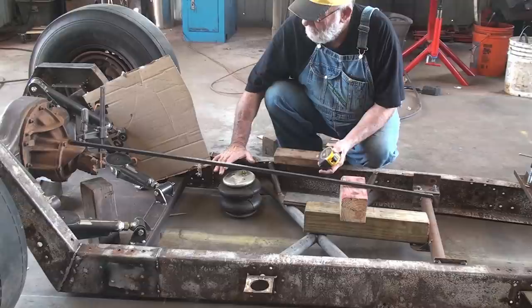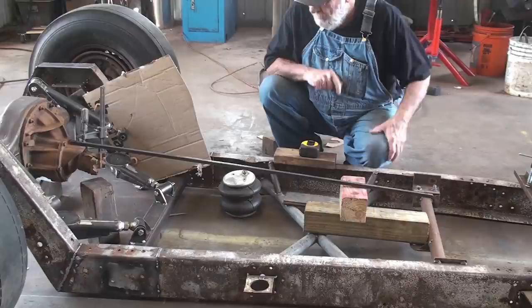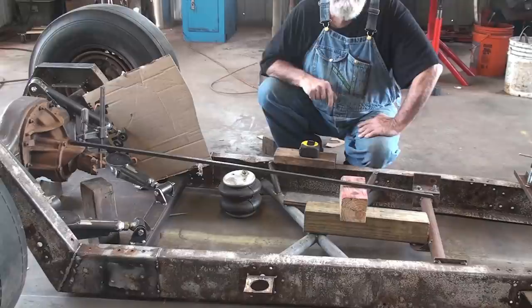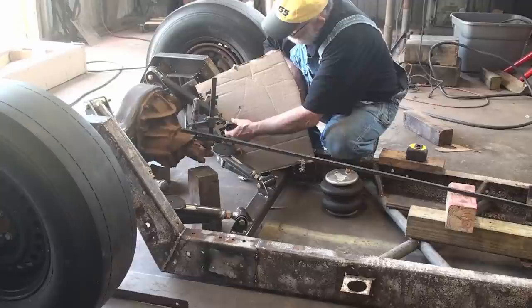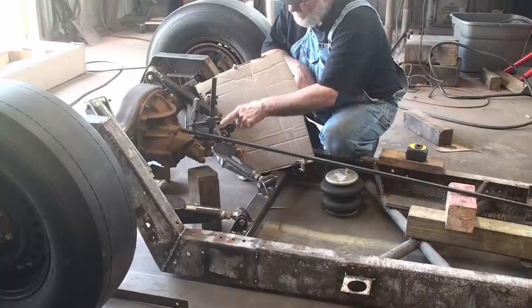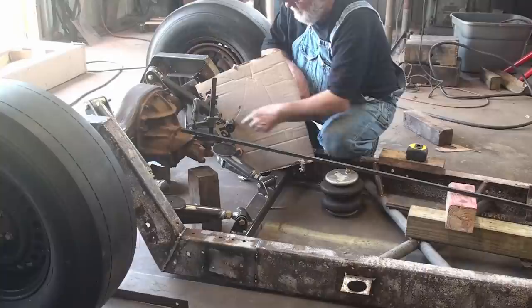So I've got the frame slammed all the way down on the ground. With the rear end exactly like it is, the driveshaft will be pointing at the tail shaft like it's supposed to with the frame slammed to the ground. And this is the really weird part — this is a rat rod, and these are highly classified rat rod scientific calculations I'll be showing you right here. We've got the bottom four links on and the back part of the top link. What we need to do is determine where the front part of this link needs to be — put it in the wrong place and the rear end won't be pointing at the tail shaft.